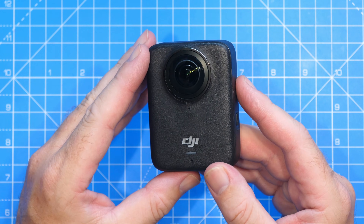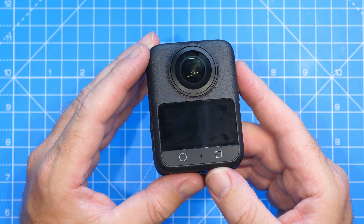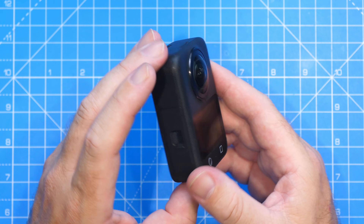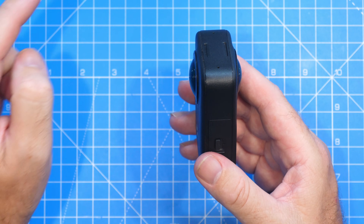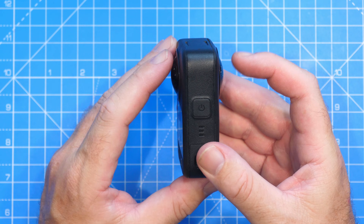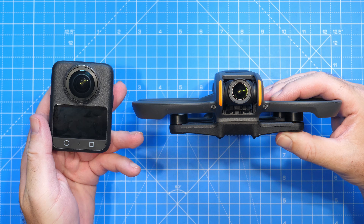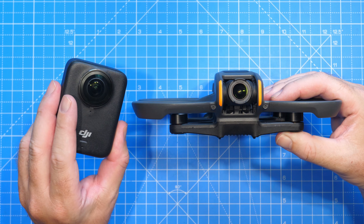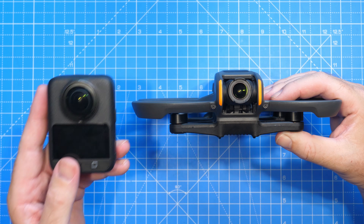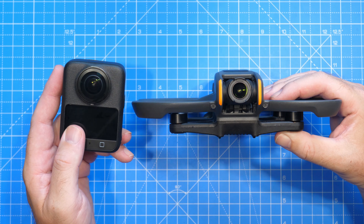When it comes to capturing 360 imagery though, things are a little bit different. Not only do you need more than one camera, you also need extremely wide angle lenses, or what are known as fisheye lenses. These allow the camera to pick up a massive field of view around it, and then the software in the camera actually stitches the two images together from the cameras to give you that 360 image. As a result of those very wide angle lenses there are compromises in the way the footage is captured, and even though these cameras can have the same megapixel and size sensors as a normal camera, it doesn't mean it's going to produce the same kind of image.